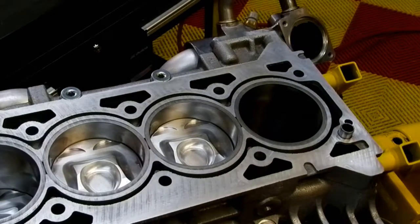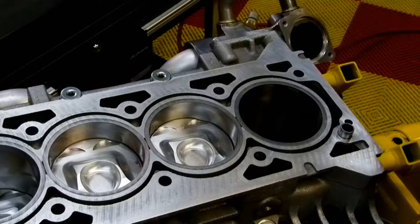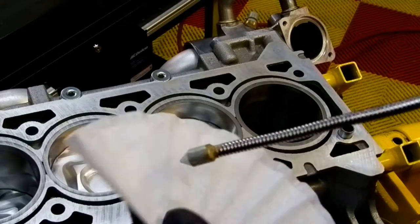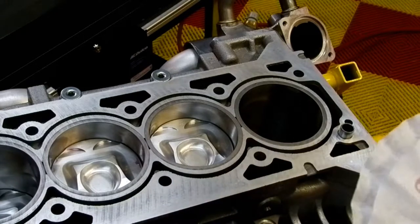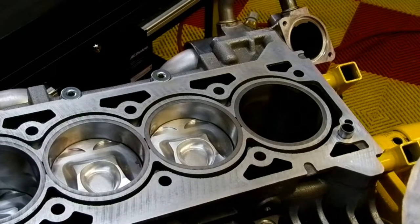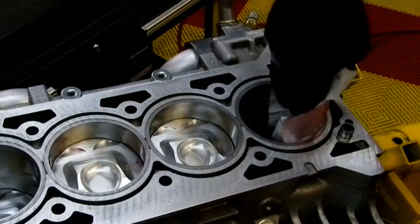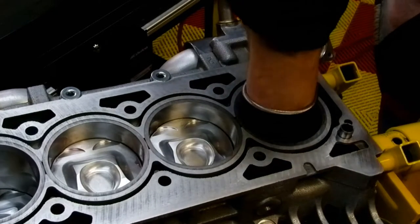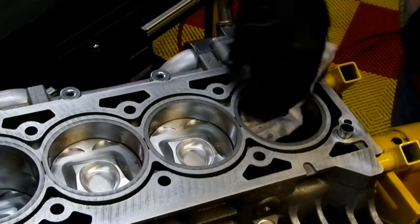So what I do is, once again, I use my coffee filters, just because there's absolutely no lint on them. I take the coffee filters and put a little ATF on it. Now the beauty of ATF is it's very anti-corrosive, and when I clean the bore with this, you basically just keep going until everything looks nice and clean. So you pull the coffee filter out. If there's any remnants, any dirt, grime, grease, whatever,